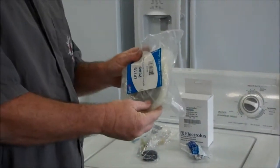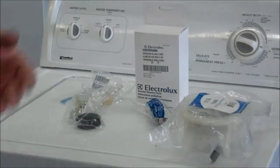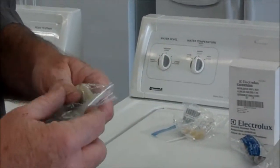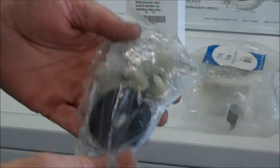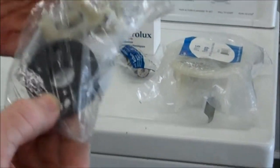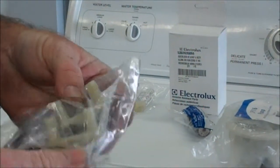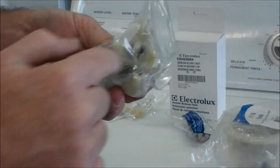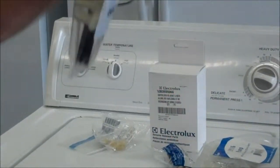This is a Whirlpool-based water pump. That's going to cover Whirlpool, Kenmore, Roper, Estate, KitchenAid, and some of the Maytags from 2007. This is a motor coupler — it's kind of like a U-joint in a car. You can get good used ones of these, but you really don't know; this plastic cracks sometimes. That doesn't happen as much now because they have a metal insert in here. But you don't know what kind of stress this thing has been under, and they're not very expensive. I recommend always using new couplers.